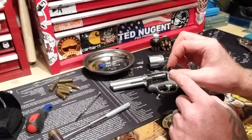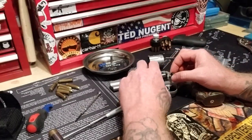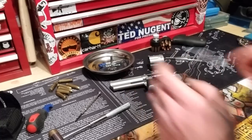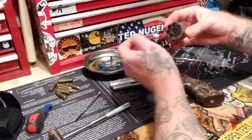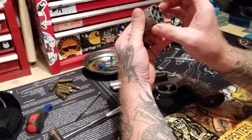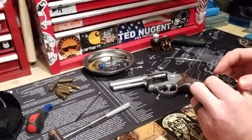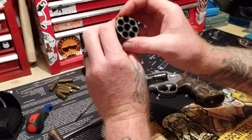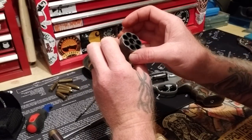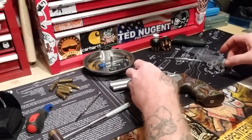The smallest end goes forward. The wide mouth portion goes to the back. And I just kind of clean up the gunk around it and slide her back on just like that. Now that you've got your cylinder off, that's pretty simple stuff. You got a couple of things going on in here, but there's one item I need to get out of the other one. This one I'm just doing an inspection — I want to make sure there's nothing caught in there. There's nothing really in there, so I'm good. I could clean that up before I put it on. Set that to the side.